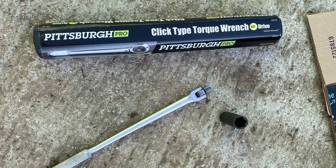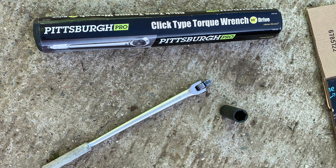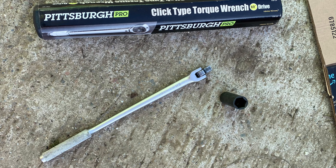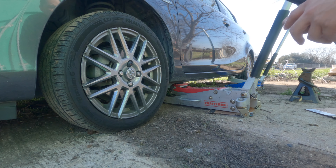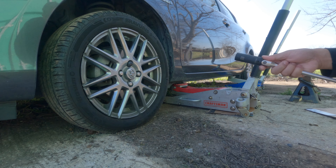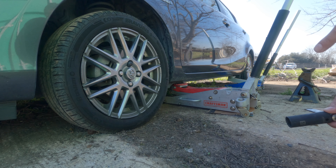Now this is pretty simple. Other than the two jacks, we're just going to be using a breaker bar, a 21 millimeter socket, and a torque wrench. Some people say that's optional, but torque to spec please — it's important. These are your tires, you don't want your wheel falling off on the freeway. Before you jack the car all the way up, make sure you loosen your lugs first, otherwise it's going to turn while the wheel's up and you're going to have a hard time getting it off.